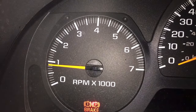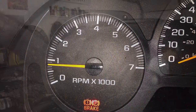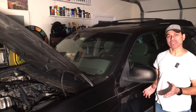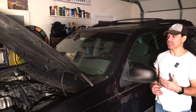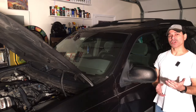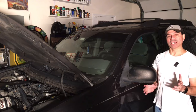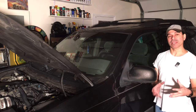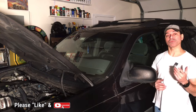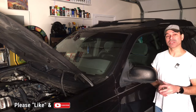The RPMs are looking really good — that is the normal range for this particular vehicle at idle. Everything sounds good; the RPMs are idling nice, not idling high, which would normally be indicative of a vacuum leak. Definitely not manifesting the issues it had before. Also, before we were hearing a high-pitch noise when accelerating from the vacuum leak sucking in — that's all been taken care of. For around $10, we went ahead and fixed that air intake duct instead of replacing it and spending upwards of a couple hundred bucks. I hope this video was informative. Please like, subscribe, and send me any comments. I'll see you next time.